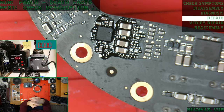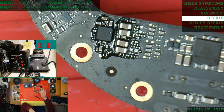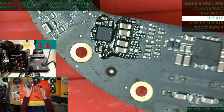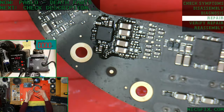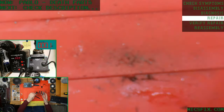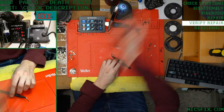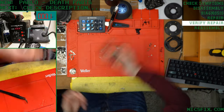Could those caps be measured with a multimeter? Yes, they can. If your multimeter has a capacitance mode, you can read their reading. You can take their resistance, but from what I've seen, usually when these are going bad like this, they still appear to test fine with those methods, which is why we just go straight into powering the board on and seeing how much DC it's pumping out to judge how bad the caps are. That seems to be the quickest, easiest, and most effective way of testing these caps, with them under load installed on the board. Every time I pull off these bad caps, more often than not, they have the right capacitance and they read the same resistance as good ones. So it's one of those things that seems to only fail under a certain load. I'm sure there's equipment or ways to test caps like these easily off the board, but it's easy enough to just test it with them on the board and check with the subwoofer plugged in and a multimeter on the subwoofer.